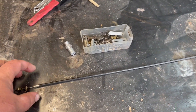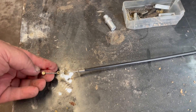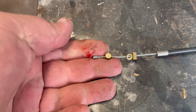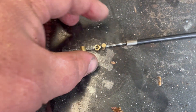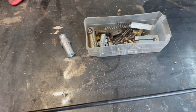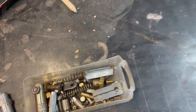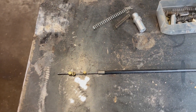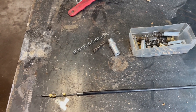Here's one of my blank cables — I'm sure you can buy these in Australia but I found them online in the UK when I was buying Villiers parts. They come with one end already soldered in and three different ends for you to solder on — actually fantastic because the ones you don't use go in a drawer. That's ideal for when you drop one, like I did yesterday. I'm a wood turner so my shed floor has sawdust everywhere — a small brass fitting is really easy to lose. But I had a drawer full and grabbed another one. Now I'm going to start measuring up for the decompression lever.